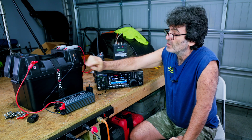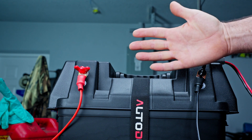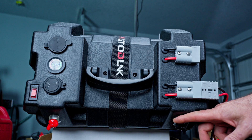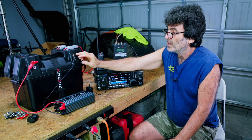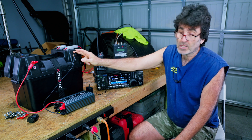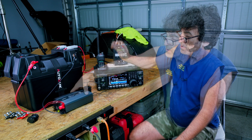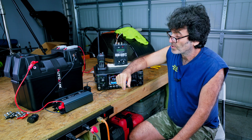These front wingnuts are unfused. I do like that they're insulated right here — that keeps any dangers down from something falling on top and shorting across there. When you're just storing the box, they are safe. The plastic nuts behind here are insulated as well. But like I said, this is unfused, and you can hook anything to this that your battery will put up with. I've got a small 500-watt pure sine wave inverter connected to this. It works very well — good for small lights or a fan, but it won't run a coffee pot.